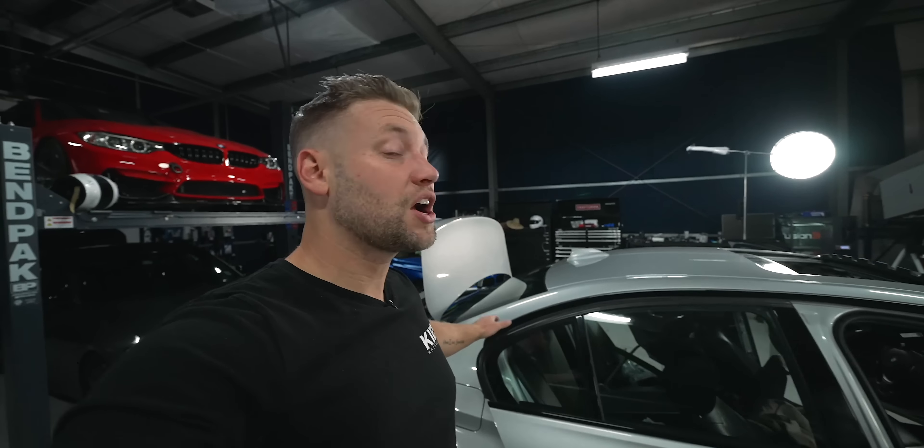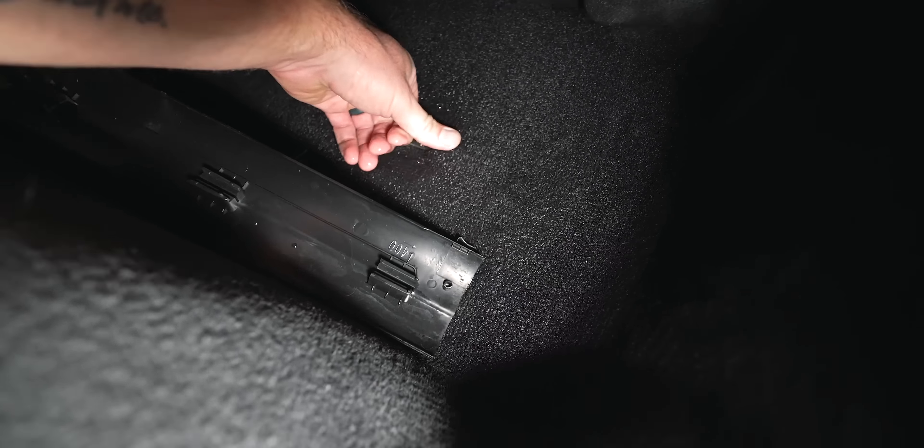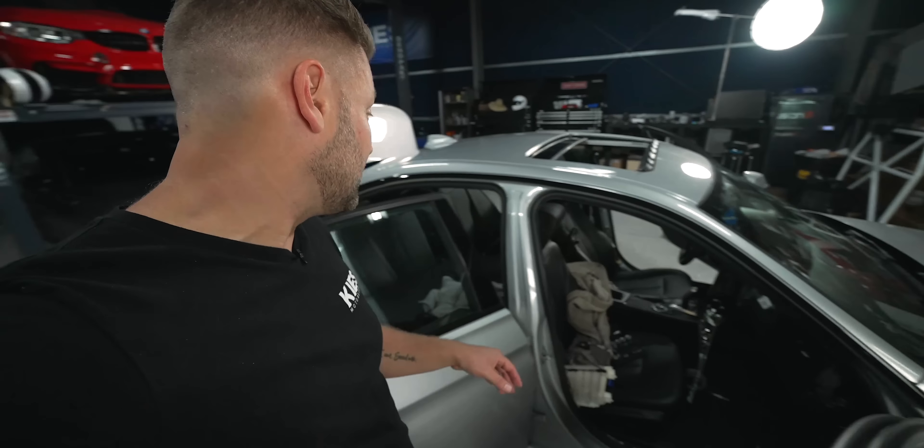Everything in the car is still completely soaked. The seats are wet, the floor — I'm kind of nervous. Now, before mold and mildew have a chance to set in, I'm going to pull out the seats, the front ones, completely remove the rear seats, which seems unnecessary until you see what we're up to. And then the most daunting task — I need to take up the entire carpet and honestly just throw it out and get a new one.